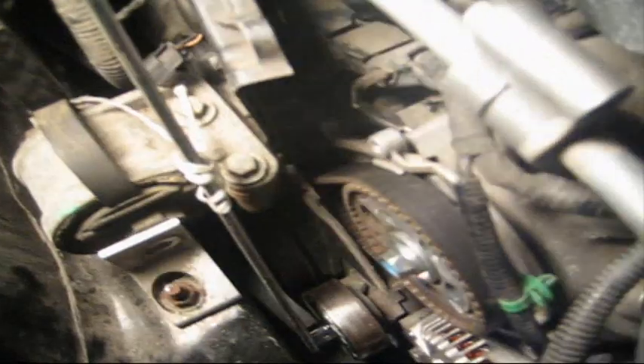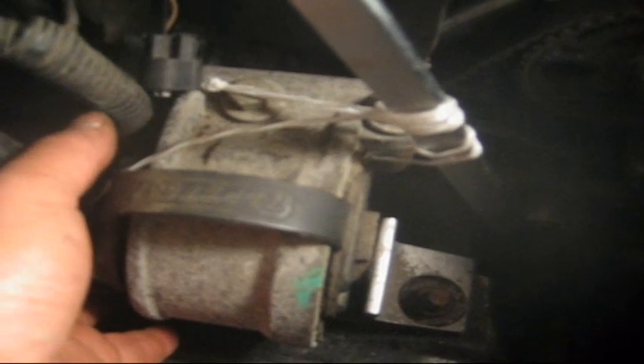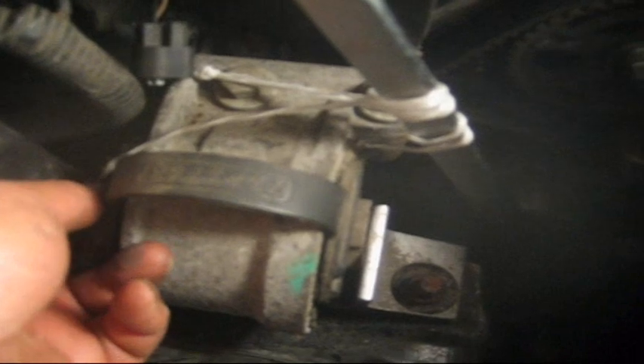What I have to do next is get the belt back on and drop the engine, then get that bolt back into the engine mount. It's getting too cold to do anything out here. I have to get the bolt back into the engine mount, and I noticed back here — there's no way for me to film it — when that bolt goes through, the piece that it goes into slides back and forth. So keep that in mind when you're trying to put the bolt in and you can't get it through all the way. If that moved, you're going to have to wiggle it around to get it in.